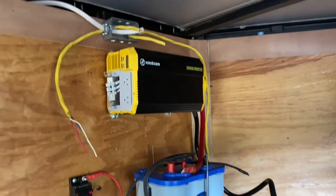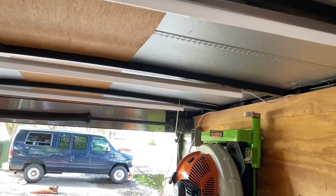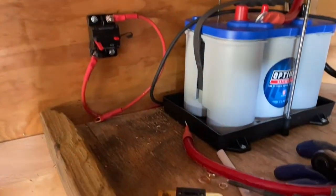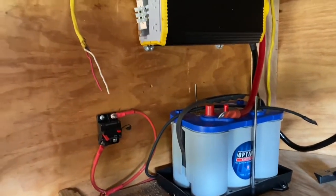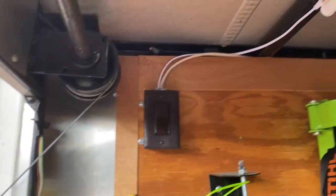We know this is where we have the inverter — we have it tied right to the trailer frame. The box on top is a junction box that everything runs to. I start running my wires to each of the boxes to get the correct lengths and tie everything together. Do not tie in the battery at this point — keep everything off the battery; the last thing you do is hook up the battery. I've also installed a 40-amp breaker that comes off the 7-pin to the battery, so while the battery is charging, if something happens you can reset it.